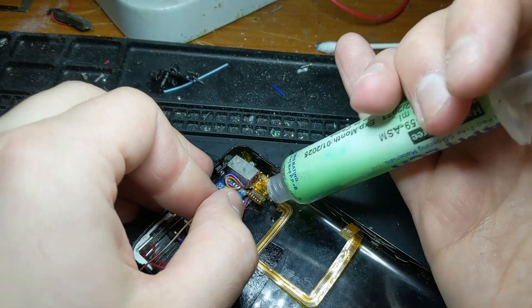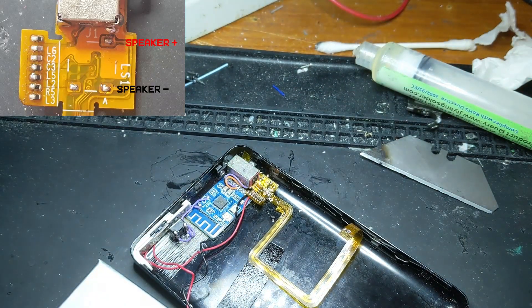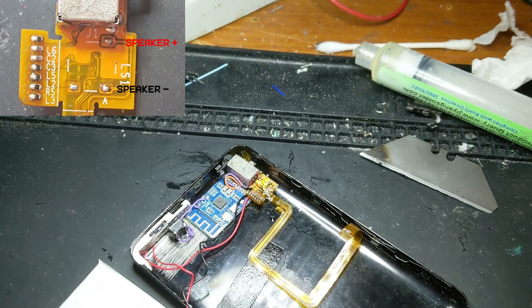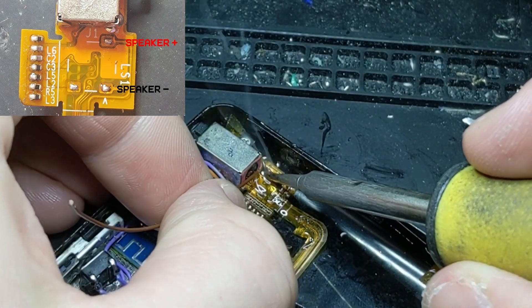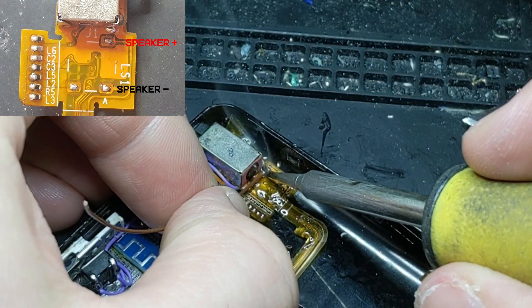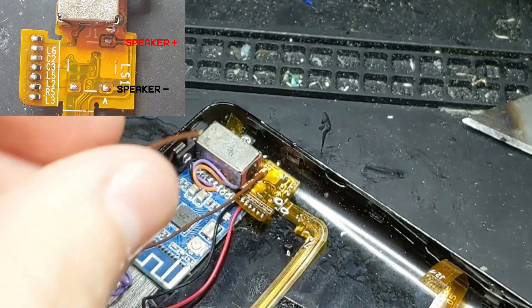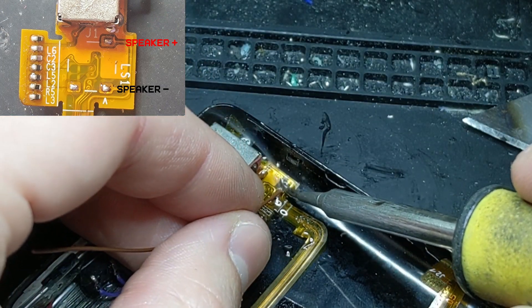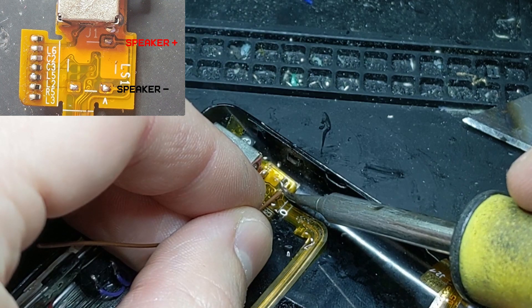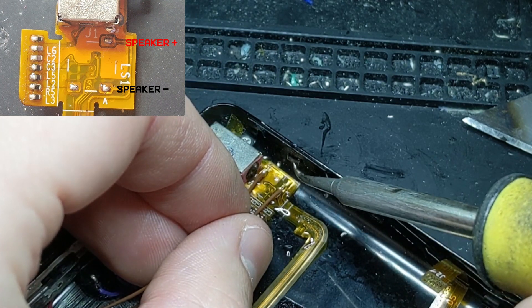Once that's off we can grab two bits of wire and hook them up to the connection points. I'll have a picture on the screen so you know which ones. The third pad's blank and it's really just there to give the clicker more stability. Although it says the top one's positive and the bottom one's negative, it doesn't really matter which way we wire these up to the Taptic Engine — it'll still work the same. It's important to use appropriately sized wires when doing mods like this, as space is limited inside and using bigger wires can cause issues when sealing everything back up. I'll have a link to the wire I use in the description. You could also salvage the wires from inside an old or broken USB cable as those are usually the perfect size as well.